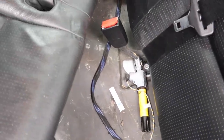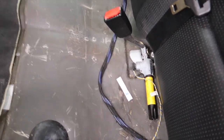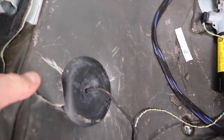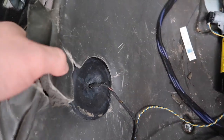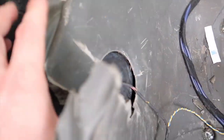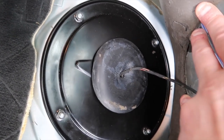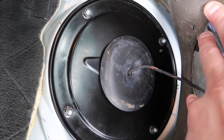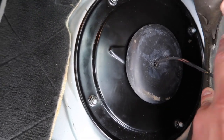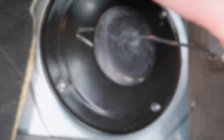What you're going to want to do is take your seats — pull up and the seats come out just like that. Then release the belts and pull them out, and you should get the rear seat out. Move that forward and you also have this plastic right here, which reveals the fuel pump and fuel filter located underneath here. There are four 10mm bolts right there which you'll be removing to gain access to the fuel filter.